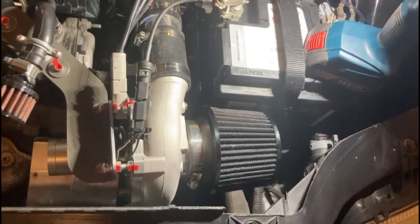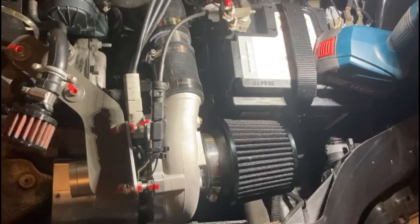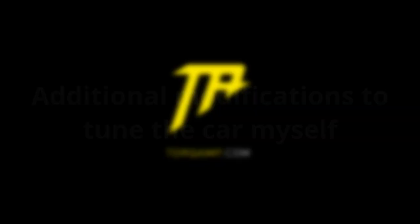Another advantage: when you look at a traditional turbo, your boost is created by the exhaust gases, which causes turbo lag and a boost threshold. The electric turbo does not have either of those issues — it can boost instantly by powering the electric motor, and is fully adjustable between 0 and 100%.